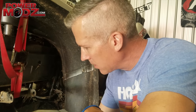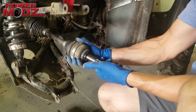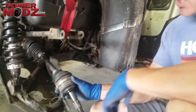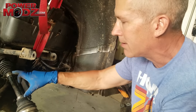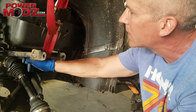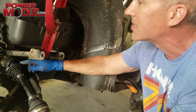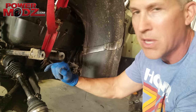These are some very tough and robust boots, but everything's got to give — especially when you're driving through swamps and those beaver sticks get impaled through there. Some guys are just grabbing on here like this and pulling from this outer CV. That's not a good idea, because on this intermediate or inner center axle shaft there are two circlips — one in here holding this CV on and another one holding that one on. You don't want those to pull out, because sometimes this one comes out and then it's a real bear.